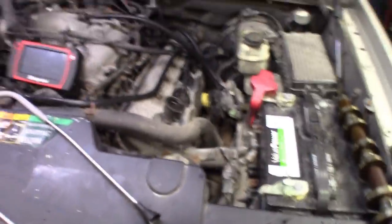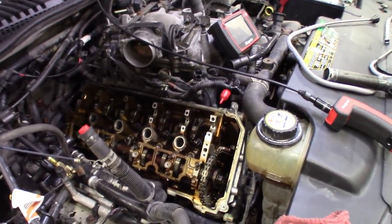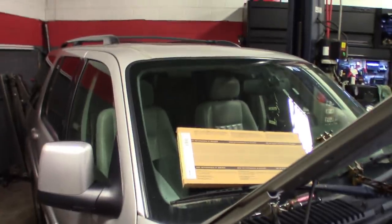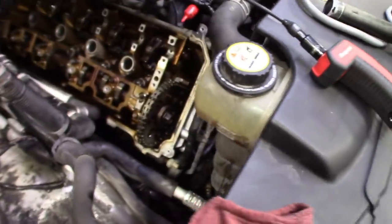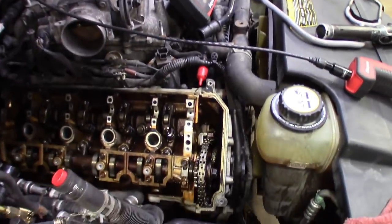Actually a pretty common fault on this - I've seen this happen before on these things. We got a bad chain here. You can see it's just broke apart. The chain's only as strong as its weakest link. So I'm down to deciding: do I want to retime this, or are we still going to pull the body off and get a motor? After pricing a few motors out, even used ones run a good amount for low mileage. And this thing needing front struts - I couldn't get the rear DVD to work either. I just don't want to go over budget. I'm actually contemplating maybe doing the timing on it. It pretty much takes just as long as pulling the body off - the timing on this calls for like 13 and a half hours.